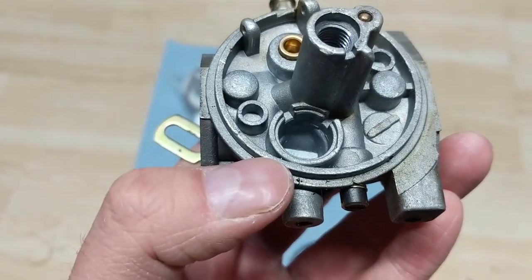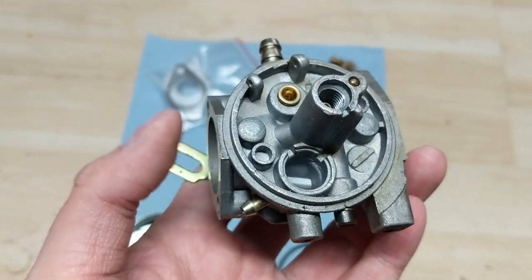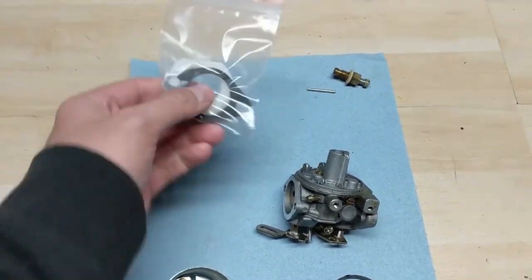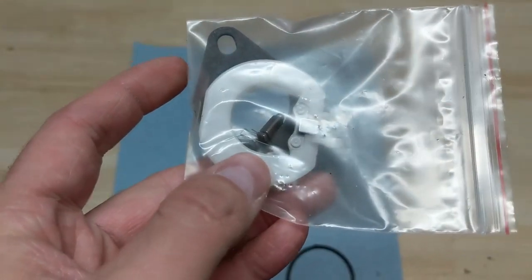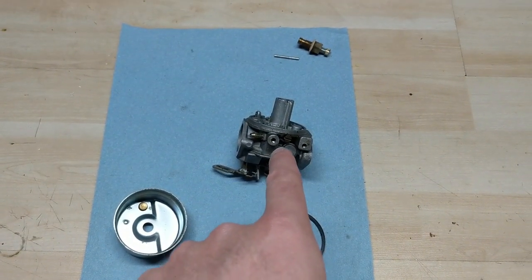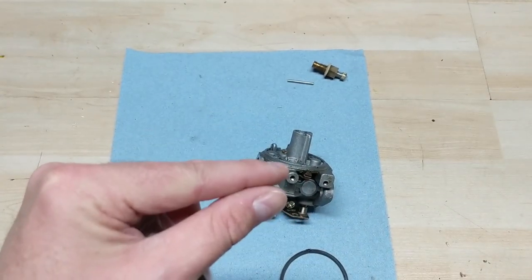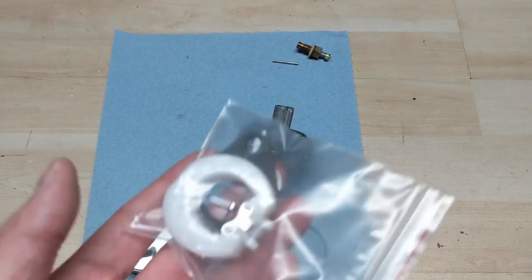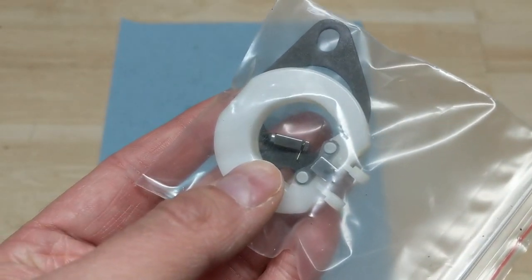You can see that it is missing the Welch plug right there — normally there is a Welch plug that goes there. It's not that big of a deal, but I'll get to why this carburetor is no good in a second. The parts stripped out of here: we have a gasket we can reuse, a plastic float — those are always nice to keep because on the older OEM style carburetors, they have brass floats that are brazed together, and every now and then the braze breaks and your float leaks. So it's nice to have these parts, plus a brand new needle valve and hanger.